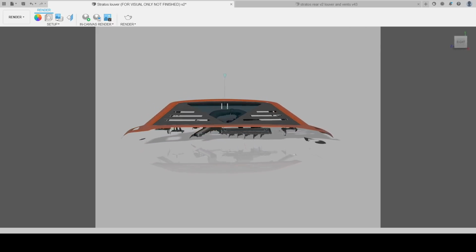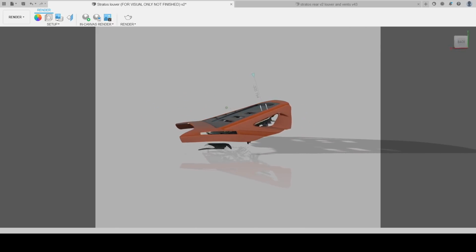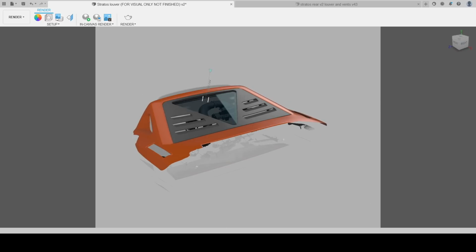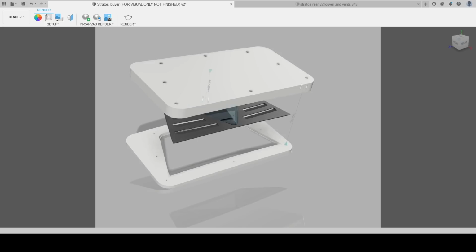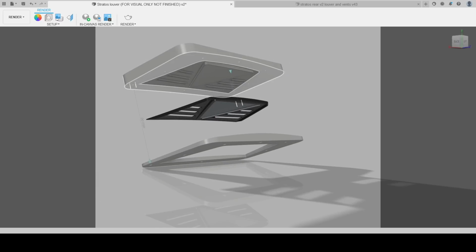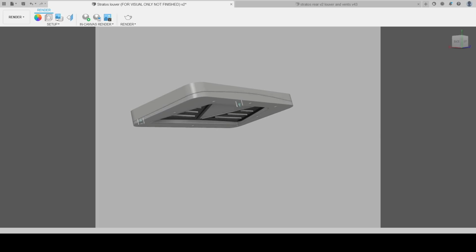And then from that CAD model, we'll design the mould tool, which will be a 2-piece MDF tool, basically CNC machined from MDF using the CAD model. And then we'll be able to lay that up in either fiberglass or carbon fibre into that mould to make the final part. That will be dependent on the surface finish. I think we're going to paint it, probably a gloss black, rather than exposed weave carbon.